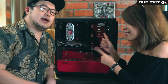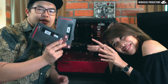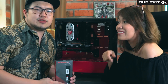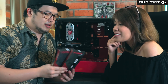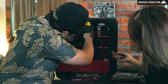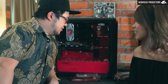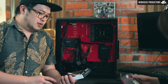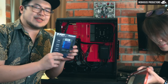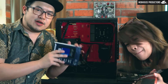Now that we've replaced the CPU cooler, it's time to remove the sad, lonely, naked little RAM module at the back of the PC and replace it with two brand new sticks of Kingston HyperX DDR4 RAM rated at 2666MHz at CL16. It's not the fastest memory out there, but it's one of the most affordable you can buy. Make sure the orientation is right — the two sticks of RAM are inserted. Now we need to install the final piece, which is an additional SSD. Today we are adding a Patriot Burst 240GB 2.5-inch SSD, and this is going to be where she stores all her games, Premiere Pro, After Effects, and all the different things.